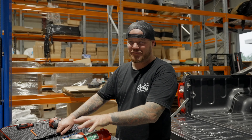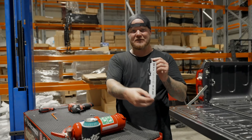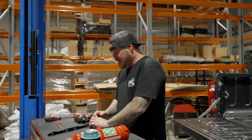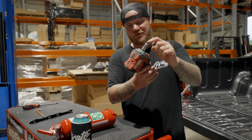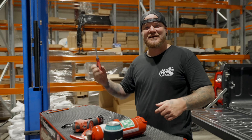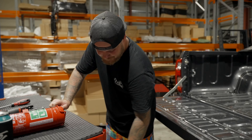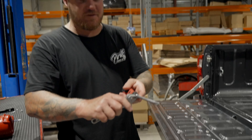You're going to buy that separately - they're about $40. You're going to open our bracket and get this bad boy here - a nice little bracket. You're also going to get some nuts, washers, and bolts. Now, what you're going to need for the install: 4mm Allen key, 8mm socket. You're not going to need the T40 - that's the Ranger. You're going to need a Phillips head screwdriver. And if your bolts are really tight, I'll show you a little trick of the trade - grab yourself a shifter.